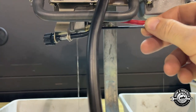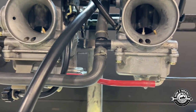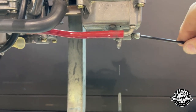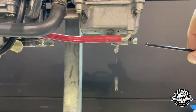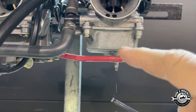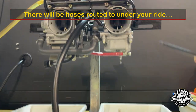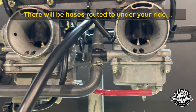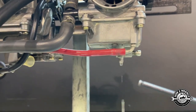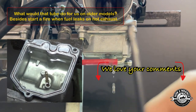Let me close these back up. Watch this — I've got that screw damn near all the way out and I have something clogged in that drain. This tells me a lot. If I pull up somewhere and I had a little drip versus full fuel pouring out, I'd want to know that, because if it doesn't leak out it leaks down into the engine and we could hydrolock a motor. I need this overflow tube to work.